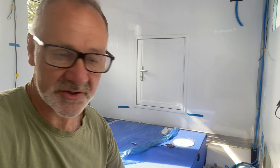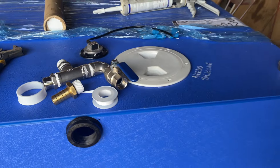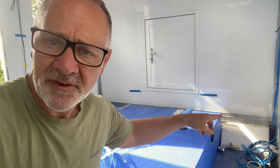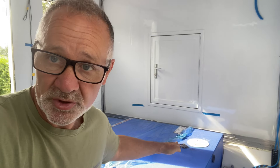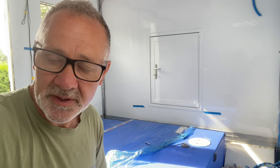Today it's all about the water tank. I've just spent about half an hour dressing the tank on the outside, because it's going to be easier doing it on the bench. Everything is really tight — by the time I get the calorifier, water pumps, and water filtration system into this space, there'll be no room at all. We've got 50mm clearance around the outside of the tank for the aluminium frame that will house the tank and facilitate the floor and seating area on top.